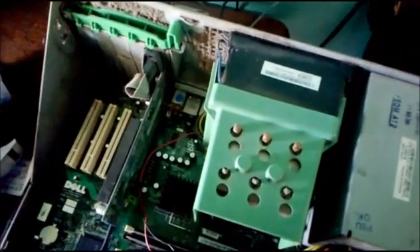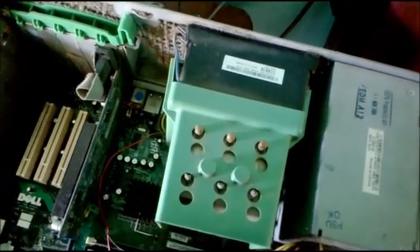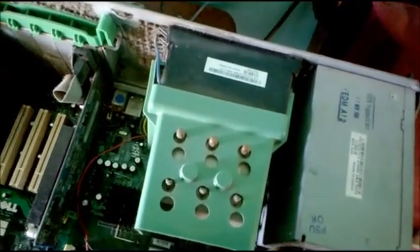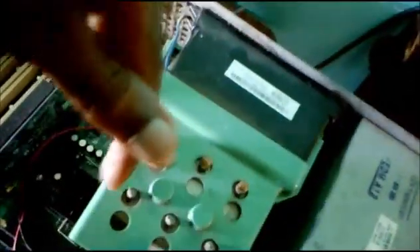I've been using my computer for months and I'm not gonna buy a new fan anyway. If you don't mind the error, it is okay to use a different fan for your computer system. But you need to ensure that your computer fan is almost as big as the one you're replacing, and that your fan is pushing enough airflow to cool down the heat sink. Guys, subscribe to my YouTube channel — I am Lens, and I'm gonna keep pushing informative content out there.